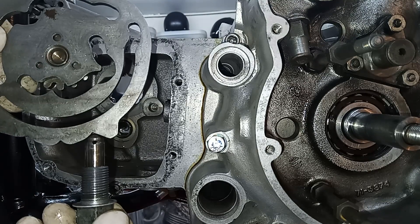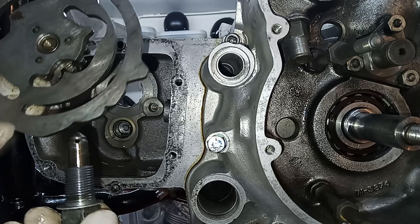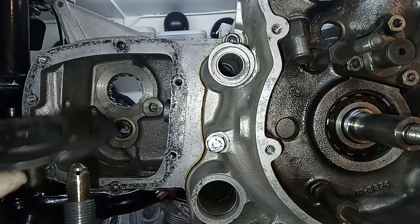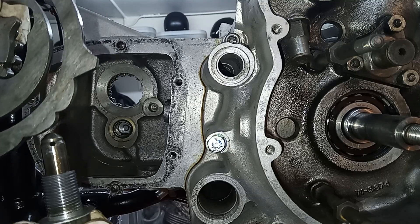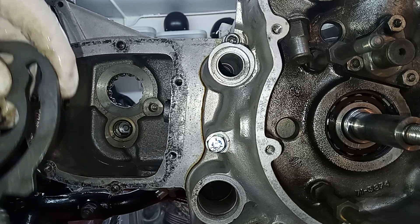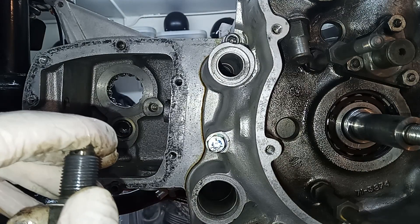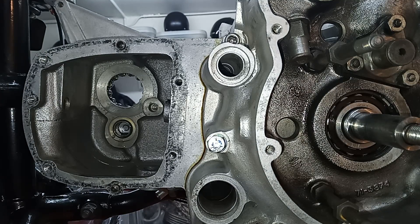The plunger comes up and it engages with these grooves. So that's first gear, neutral, second, third, fourth, and fifth all the way around there — fourth, third, second, neutral, first. And it's actually this cam plate that turns, and then this plunger, which is spring-loaded. We need to make sure that it is really moving really freely — that spring. And that's all lubed up as well.